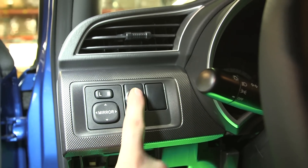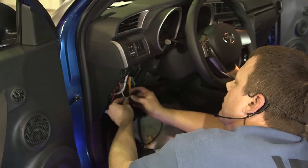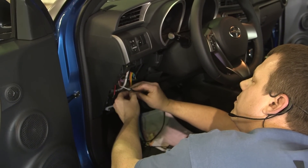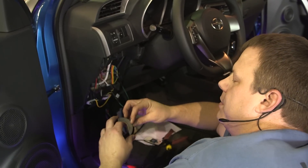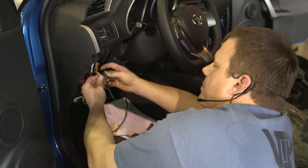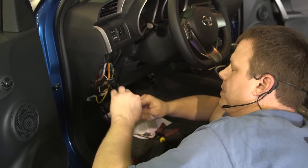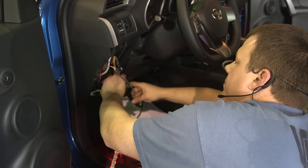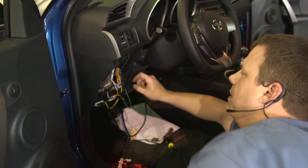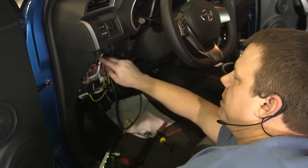There's our switch on the dash, which when the key is on will allow you to turn those on anytime. Now I'm just covering up these fuses. There's a slim chance, but there is a little exposed piece for testing up there, and if it were to come in contact with some metal it could pop that fuse. And while it wouldn't damage the car, the customer might complain when the LEDs quit working. So we're going to tape those up and then clean up this wire harness to make it look a little prettier, and keep it out of the way of all these Toyota plugs in case some Toyota mechanic decides he needs to get in here and mess with something.